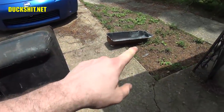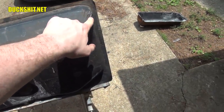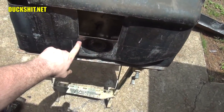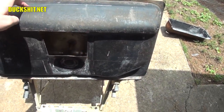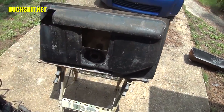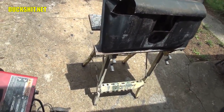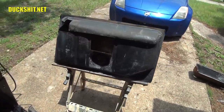While we're continuing to let that dry up, I scribed a line earlier where the edge of the top tank meets the lower, and this is approximately where we're going to be cutting. I'm going to cut on the inside of the line so that I have a little bit of extra metal in case I need to reposition. I don't think that's going to be too big of an issue. Let's start cutting this guy and see how it turns out.